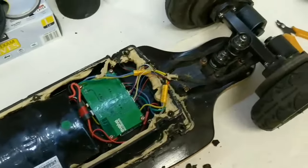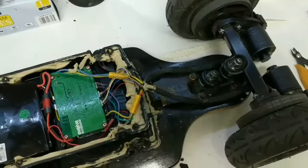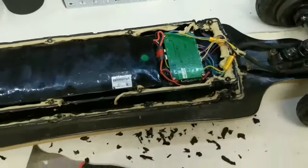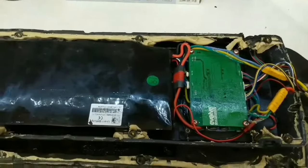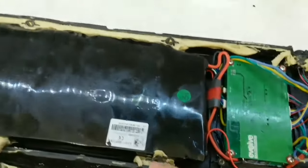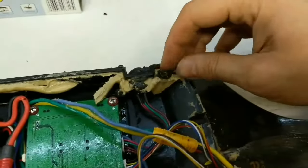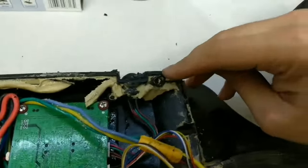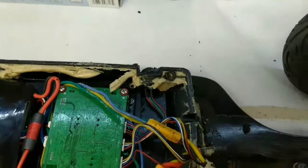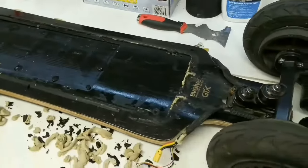There's a lot of cleaning to do, but I'm looking forward to plugging in the new motors and getting everything running again. Also important to note: there's a rubber o-ring on each bolt location. I crazy-glued them so that under compression they create a watertight seal. So I have an o-ring between the cover and the bamboo deck, as well as an o-ring on top of the bolt — over-engineered a little but it worked great.